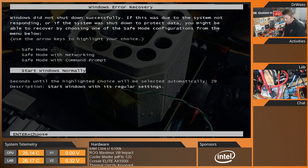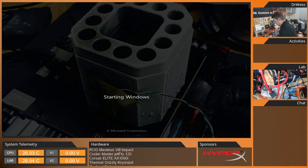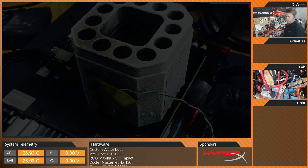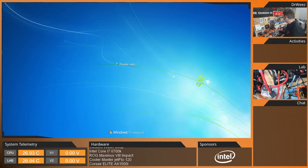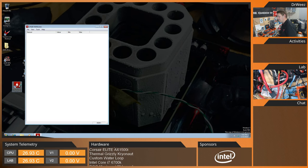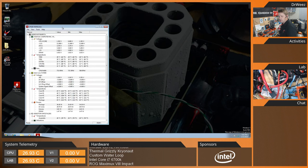That's one of the things I like to do, is just keep a book with notes in it as you're benching, just to write down certain things that happen. It's always nice to have something to reference back to when it happens again. Normally with liquid nitrogen, you want to write down what works instead of what doesn't work. So when you pass a score at a really nice frequency, say 6.5 or something like that, make note of what the temperature was, what the voltages and all that type of stuff were. That way, when things start going drastically wrong, you've got something to fall back onto, like a safe milestone that you know worked before. And when you try to make that work again and it doesn't, then you can normally tell that, okay, I've had separation of thermal paste, or this issue or that issue. It always makes life a little bit easier when you can remember exactly what was good and what was bad.